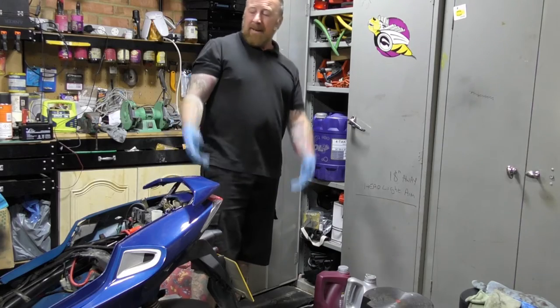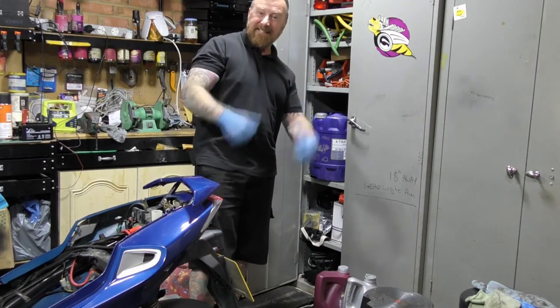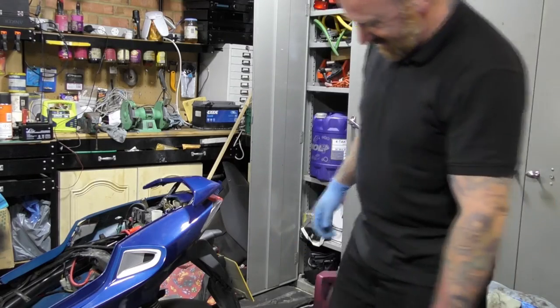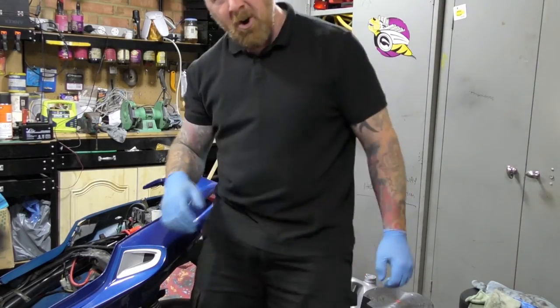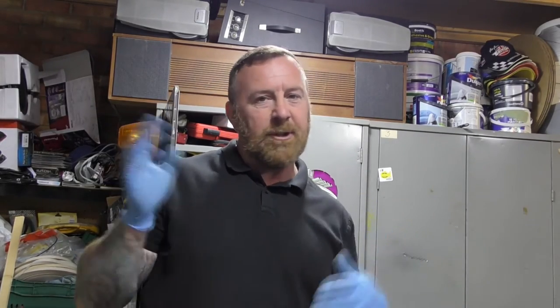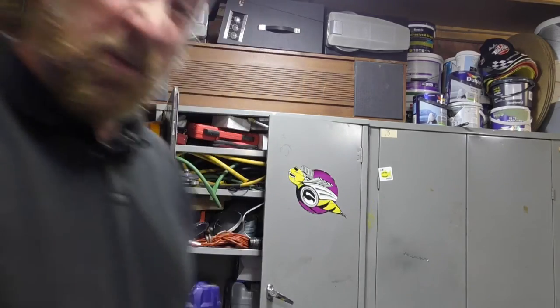Nice and simple - it's got the SC 10W40, simple stuff. Let it drain out, fill it up again - happy pet. That's pretty crap, not a lot in there if I'm honest. Now if you watch my last video on the Sinus 125 oil change, it was an inch over the stick. Don't get 4T and 2T mixed up - 2T you put it in and it mixes in with the petrol and goes in the engine. 4T should be on the stick. Let's get the stick out and have a look on this one.